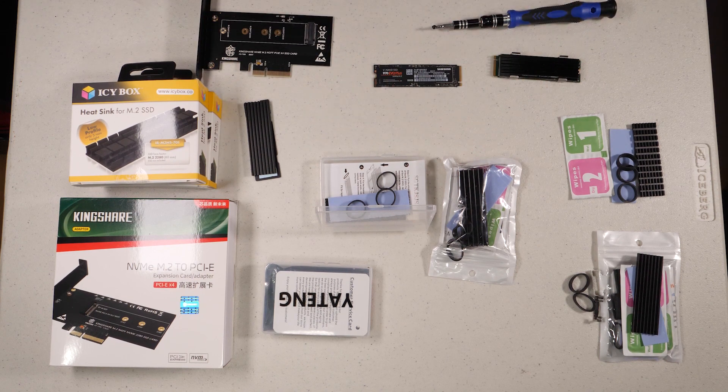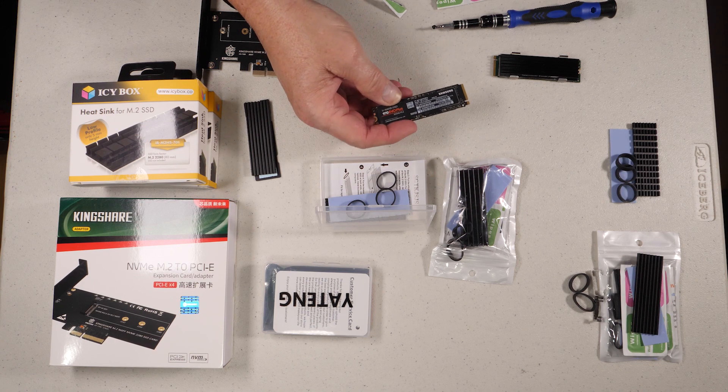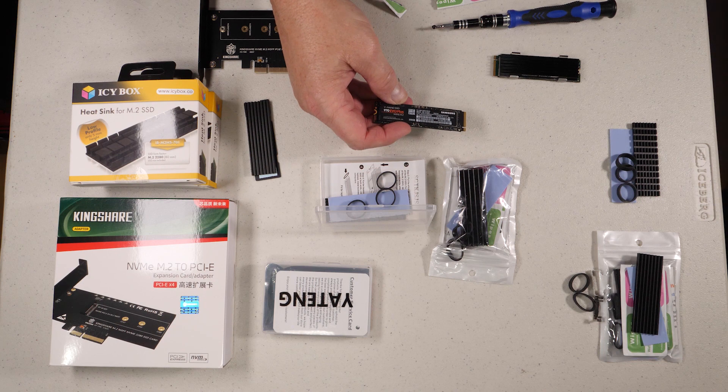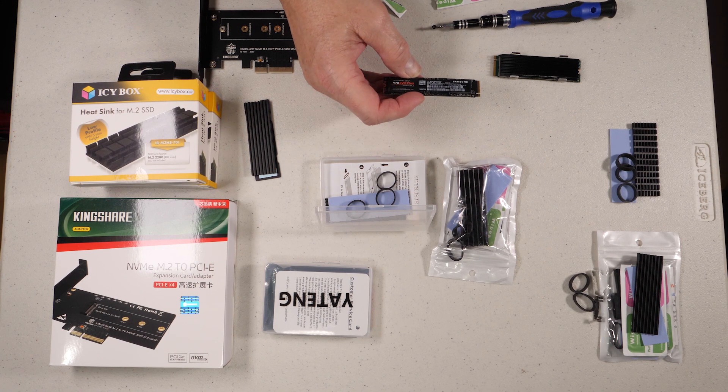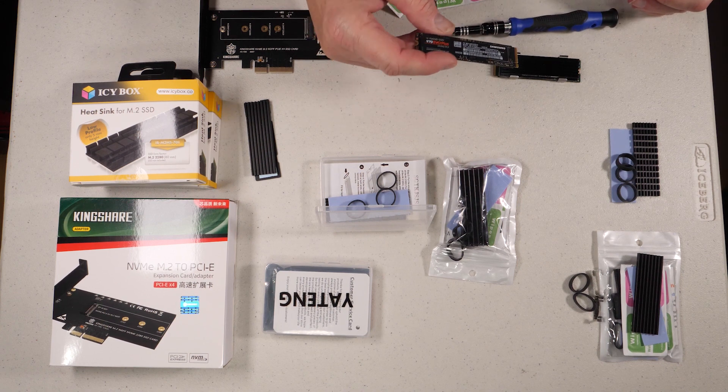Now let's mount the heatsink, pop it back into the card, and rerun that test using the same drive and the same card with this heatsink applied. Most of these work the same way — they come with a cleaner, though regular rubbing alcohol works too. The primary reason to clean the top of your SSD is for maximum thermal contact. I also want to comment on the labeling: many drives have a plastic label, some have a copper label. They're all removable, but removing them will void your warranty. If you want maximum cooling you can remove the label, but I'm going to do this with the label on.